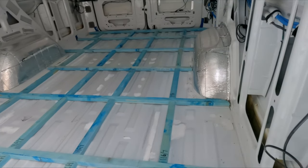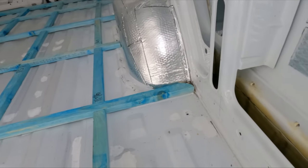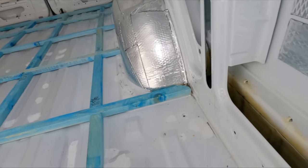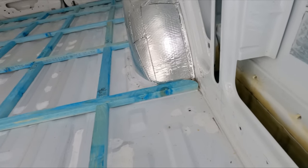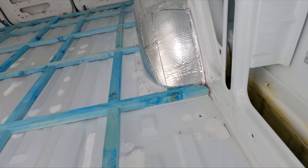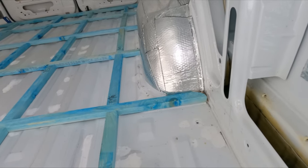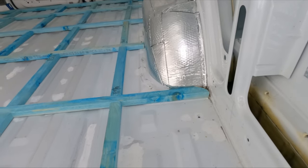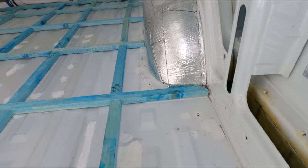The other thing as well, when you get to the wheel arches here, the gum glue, the adhesive glue around the wheel arch, you either have to level it out or shave off the bottom of the batten in the corner, because otherwise it rises high when you put the batten on the floor. So I just took the glue off, then put a load of cure rust on it, and I'm going to red oxide it and prime it. In hindsight, I should have just shaved the wood to get it to fit, really, so it still sits flush on the floor. But just a little tip if anyone is looking to put the batten straight up there.